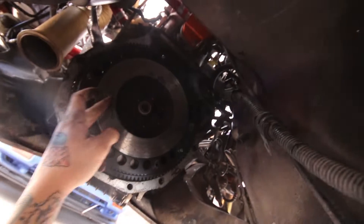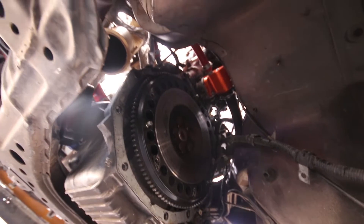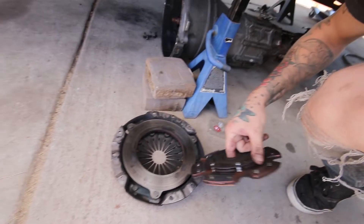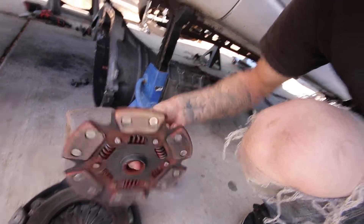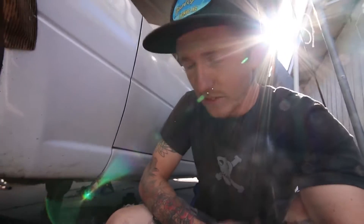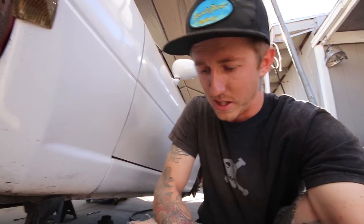A couple of heat spots — nothing crazy. Should be able to just scuff it with some sandpaper and be okay. Got that situated, sanded the flywheel a bit. Looking at the pressure plate, it has the same three heat spots, and the pucks are worn really strangely. I don't think it's an installation issue — I torqued everything to spec and lined it up with the clutch alignment tool. I think it's just because it's a cheap eBay clutch falling apart on me. I've gotta go get brake cleaner and trans fluid since I didn't pick any up yet.